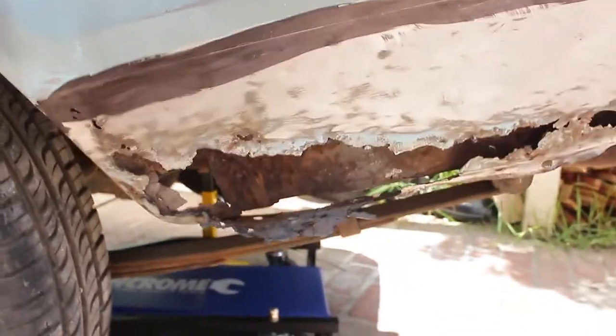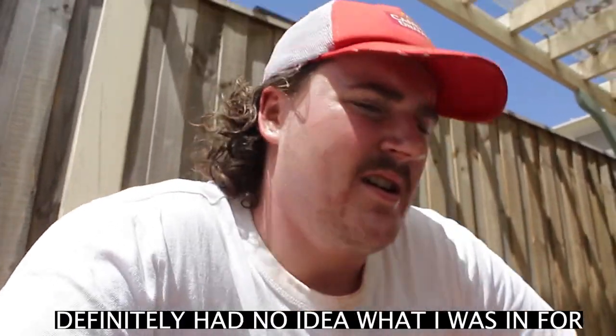So I'm just going to trim back. We've gotten through all the spot welds and it's peeled back fine. There's like a bridging point between the material behind and then the exterior panel that I can't get to the spot weld because it's rusted out. So I'm just going to cut it, and then we should be able to cut it out and then start thinking about welding it.